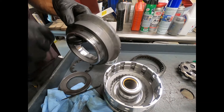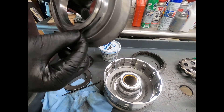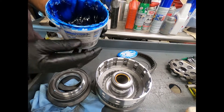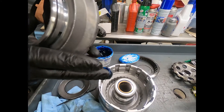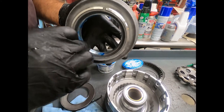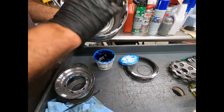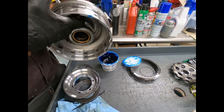For our last seal, this is the apply position — the internal seal is part of the piston housing and here's the piston seal, it's a D-type. What I particularly like to use is the light-tack blue assembly goo. They do have a green that's much stiffer and thicker, but I find the blue is satisfactory for all operations we normally do. On the Mercedes 722.6, I really don't have any troubles because they have nice beveled edges that allow the seal to slip down into position without any problem.